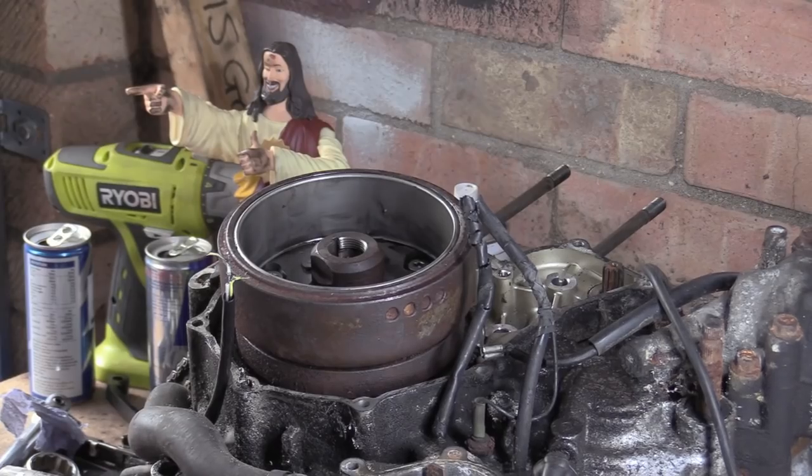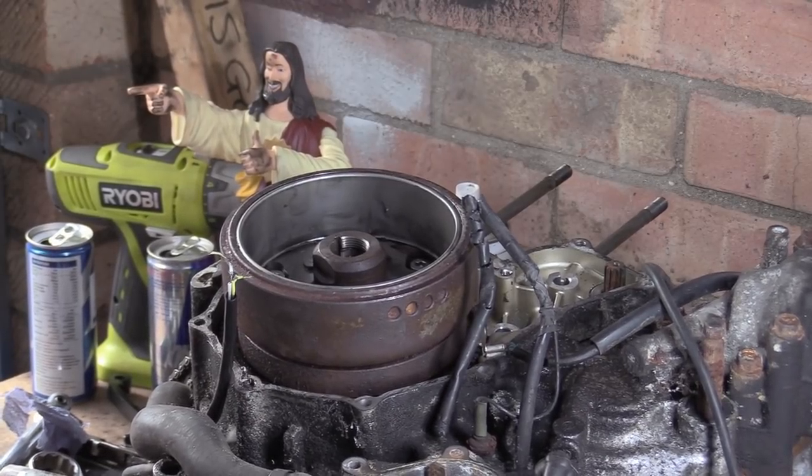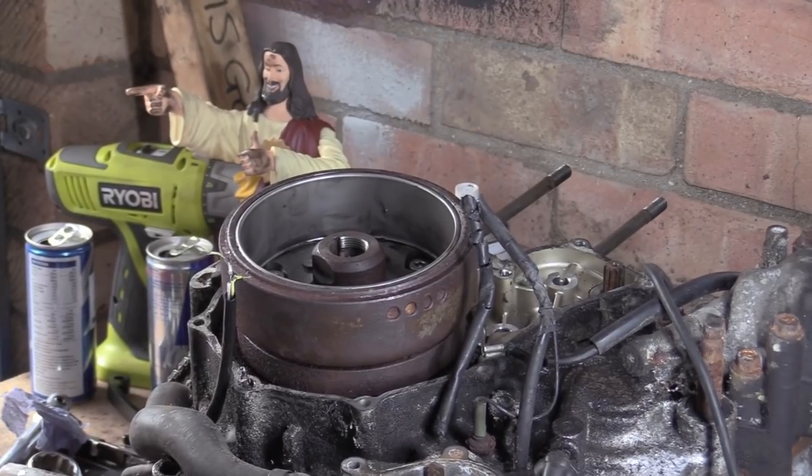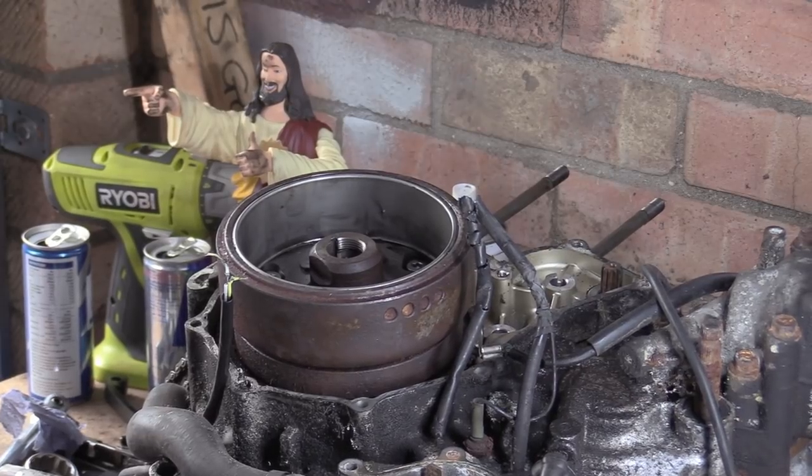It is not the magnetic attraction. I've heard that loads of times. You've got to overcome the force of the magnet. Smash your magnets, chip them off, and then still try and get it off. No, it's the taper. It is not the keyway, that would only stop rotation anyway if it was that, but it's not that either.